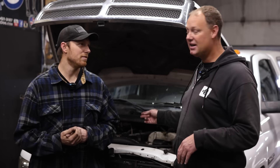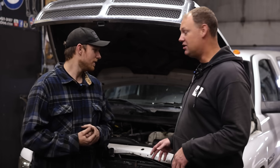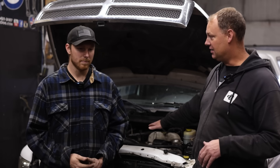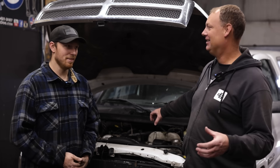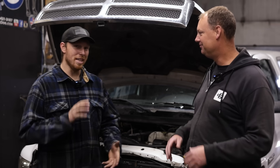We did upgrade the injectors since the last time we've seen this vehicle. Last time we had our 75 horsepower injectors — eco-friendly, super awesome. These are our next size larger Power Jets, our Power Jet Stage 2, and yes, they should pick up some power. So we've got to figure out the testing regimen. We're going to test with just injectors to get a baseline, then put an air intake on with stock exhaust, then airbox comes back off and we put in aftermarket exhaust, then the final airbox back on. We'll do each one individually so we can see how much power each one makes on its own and together. And we will put to rest the question: is it smarter to start with an air intake and exhaust, or smarter to start with a turbo and tuning? Let's get started.